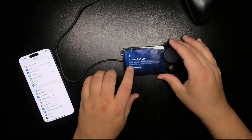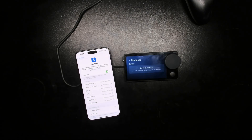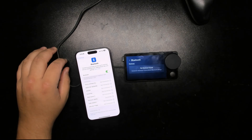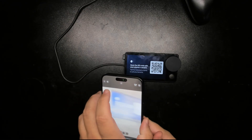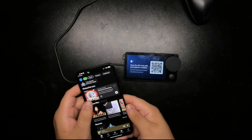Now we're going to go over connecting to the internet on each OS. I'm going to start with Nocturne first, since that one gave me a lot less issues. To connect your Car Thing to your phone, first make sure it's not connected to a computer, as that can potentially cause issues with connecting to your phone via Bluetooth. Once connected to a different power source, go into your phone's Bluetooth settings, look for the device named Nocturne, and try to connect. It will prompt you to confirm a code — hit Accept or Confirm on your phone and Car Thing, and it should connect. If you haven't already turned on your personal hotspot, do that now. Once you do that, you'll be prompted to scan a QR code. Scan it and allow your Spotify app to pair the Car Thing to your account, and you should now be able to control Spotify.